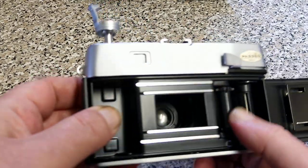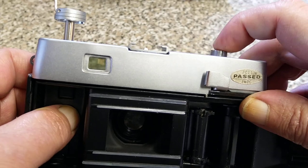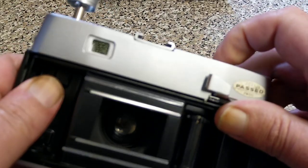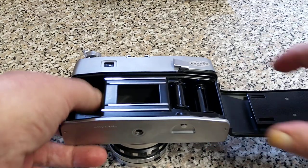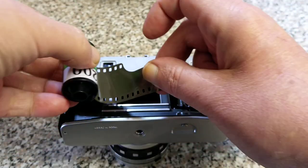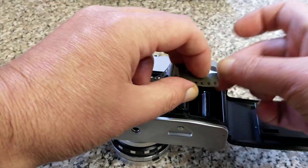You can see this is where the film runs across, and you can see inside — it's a leaf shutter. Let's see if we can fire it off. Slow it down and open it up — very quiet and discreet. This is where your film cassette goes in on this side. So let's pop a roll of film in — just to show you how to load the camera. I have a roll of C200 here. The film goes in this way around, so this little bit goes at the bottom. It just sits in there like so. Pull your film across and this will feed into a slot on the take-up spool.